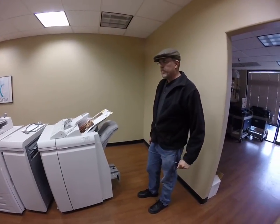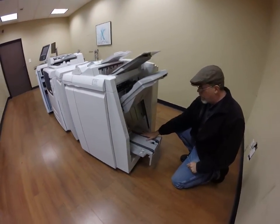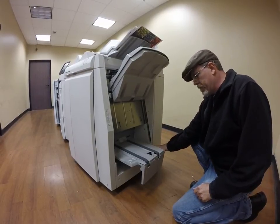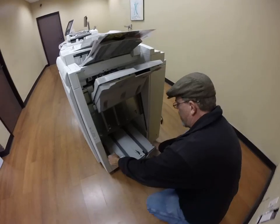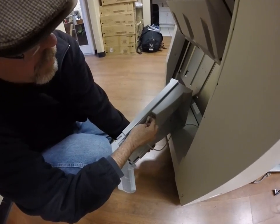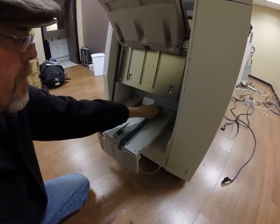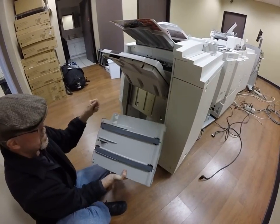Lastly, for shipping, if you're going to be moving this printer, you'll want to remove this conveyor. It normally just sits on here on three hooks, but you'll have to take off what looks like a standard data cable — it has a clip on it right underneath here. You depress on it and remove the data cable. The conveyor is held on by three hooks: one, two, three. You simply lift and remove, and the conveyor comes off.